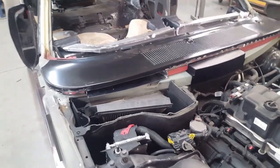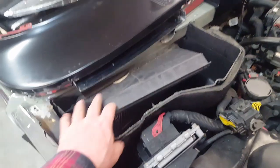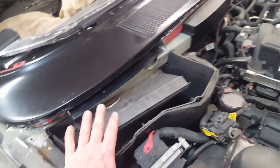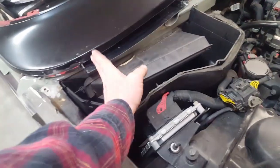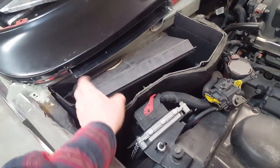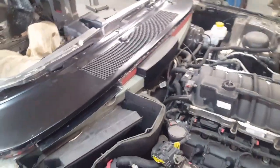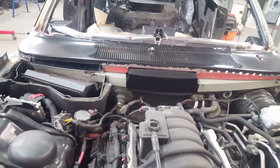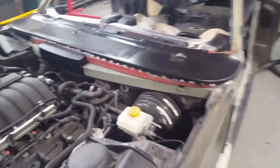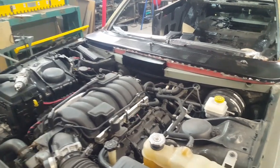You can see this is the bottom of that plenum — the air should turn this corner and exhaust out into this box right here. A cover still has to be made for this box, but before that can all be done, the inner structure of the hood has to be hung with hinges and I need to figure out where to clear out for attaching those hinges — the fenders are way in here, so you need clearance if you ever want to take a filter out. It's a nice feature to be able to change it. Anyway, time to take it back apart, take the plenum out, weld and seal it all up — all of that has to happen before I can permanently attach it to the bottom of this cowl.